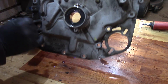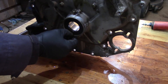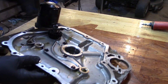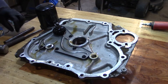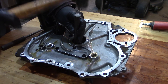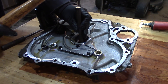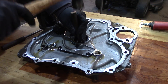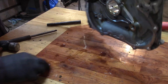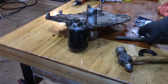Taking a look at the old seal — this was leaking. I can see right now where it is; it's down about 3/16 of an inch from the rim. So we're going to flip this over and I'm just going to take a punch and carefully knock this out.